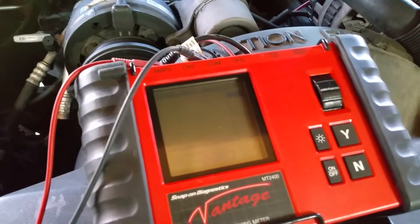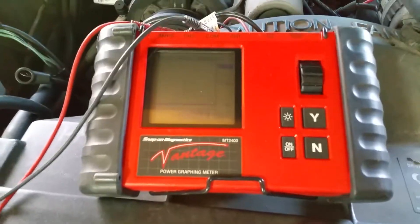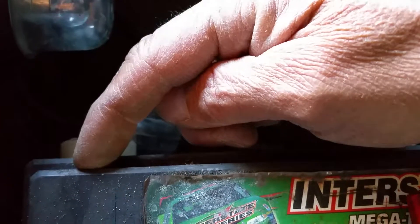The way we're going to want to wire our equipment in is we want to make sure that we put it in series. We're going to take one lead from our test gear and hook it to the wire itself, and the other lead will go to the battery. Then all of the amps flowing from one wire will go into our test gear, come all the way back, and go into our battery. That's hooking it up in series.